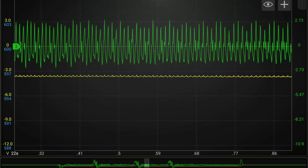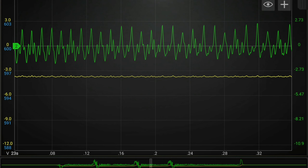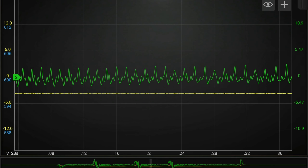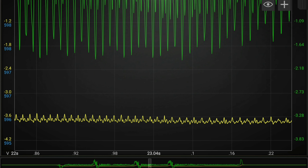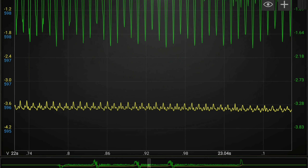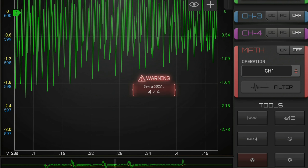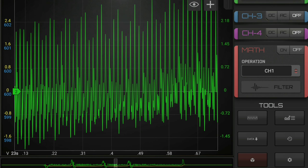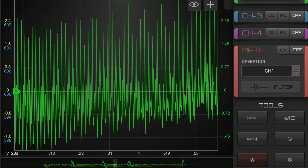It's just that occasionally the car would go into limp mode. The service data tells you to do some scan tool tests, check resistance in the wires, and if all that's good, the next step is replacing the PCM. I'm not buying that. If anything keeps pointing back to the MAP sensor, I'd take a shot on a MAP sensor — see if the voltage looks a little bit different or if it's much more responsive. Right now if we were looking for a problem with an intake pull, we'd be getting some good information off of this.